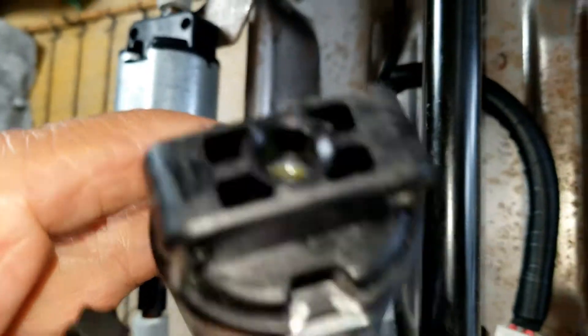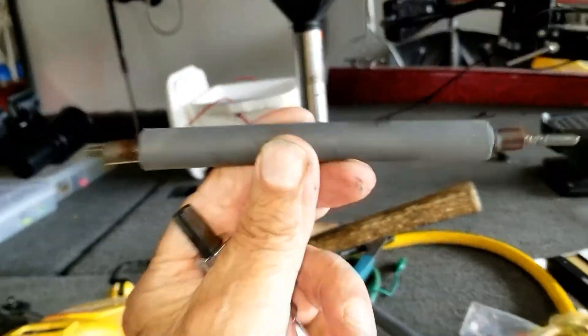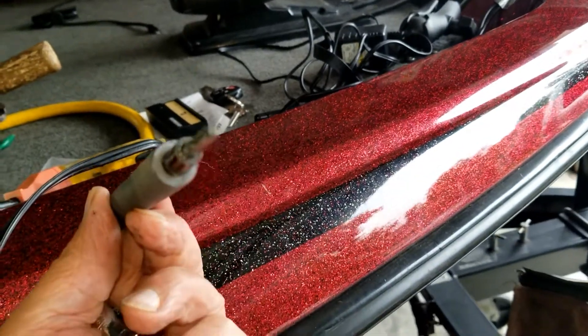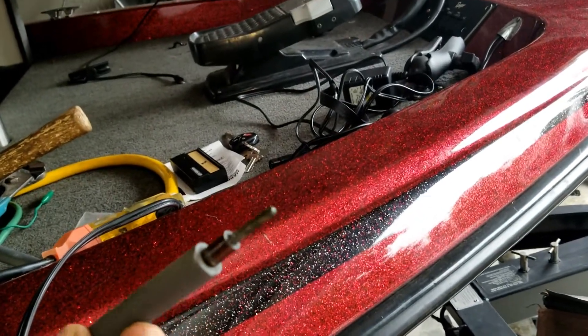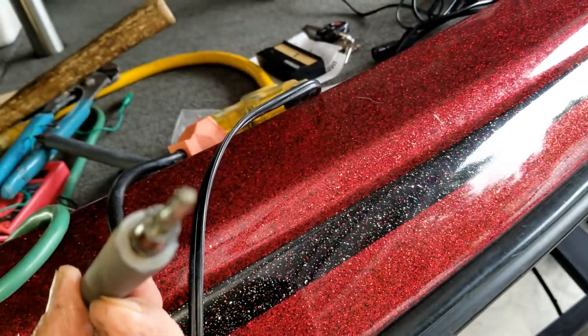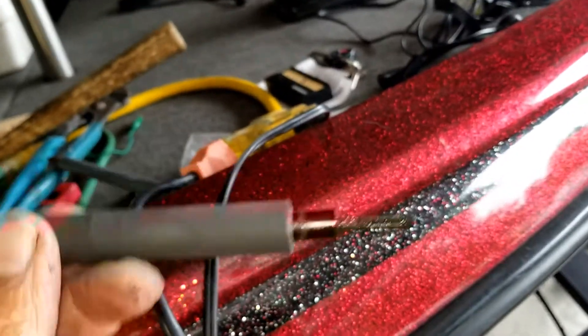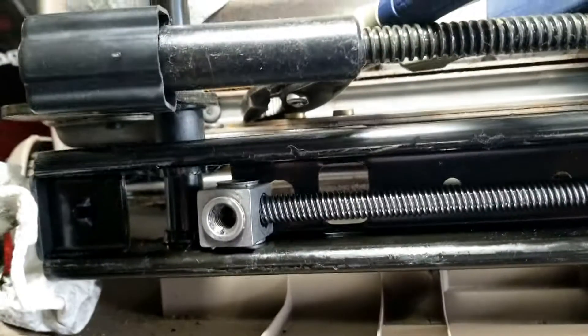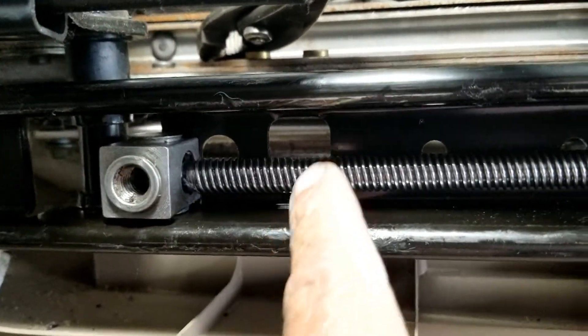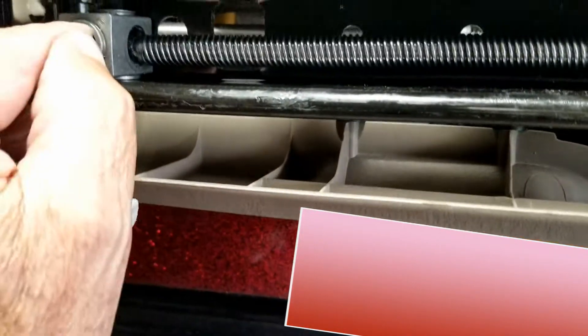The rods are very simple, they just go in here. They're little square thingies — there's one right there. Again, it just has a little square nub on the end. You take both of those, one from each end, and then you can operate these independently. The T-50 bolt that we took out earlier actually goes in here, and then this is a worm gear that is turned by the motor. It goes backwards and forwards, this block does on this track, and it moves this entire piece on the track.